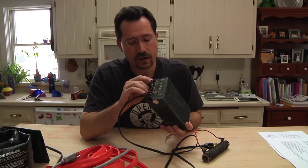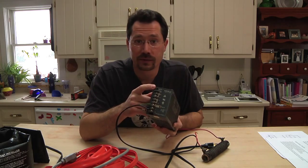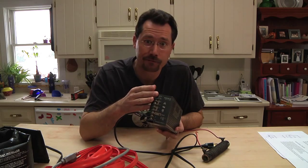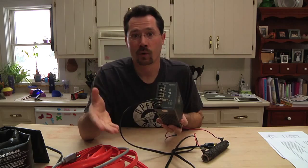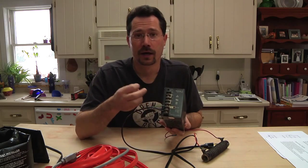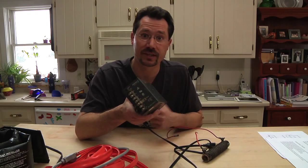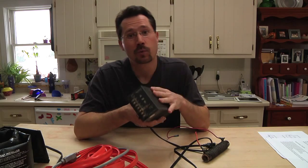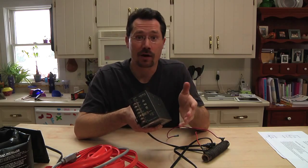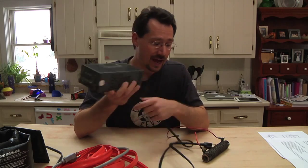The other cool thing about this is there's an adjustment knob up here. It can vary the output voltage from as low as 9.5 volts up to 14.25 volts. And 14.1 volts is pretty common for charging a 12-volt battery. So I'll basically be able to use this to take power from the EV battery pack and keep the 12-volt battery topped off for running the headlights and everything else when the engine is not running.